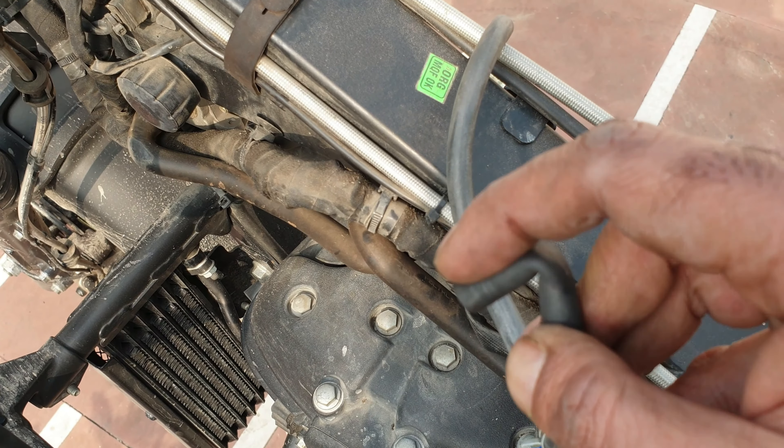I'll open the fuel tank and insert a wire. This is for evap — just next to it on the left side is the one. I'll insert this wire and it should come up. Yeah, it's not clogged or anything. I do this to make sure that when I wash the bike or when it's raining and I'm riding, no water seeps in from here. If that drain is blocked, water will eventually enter the tank — and that's how you get water in the tank.